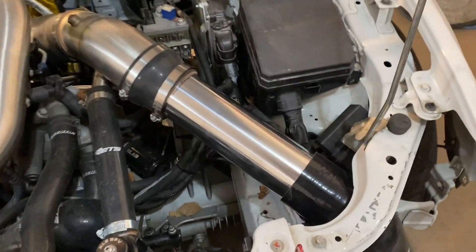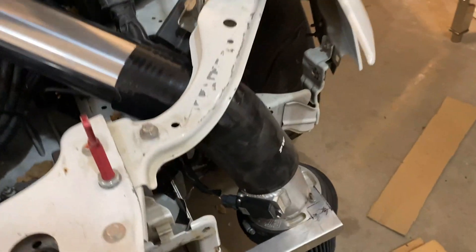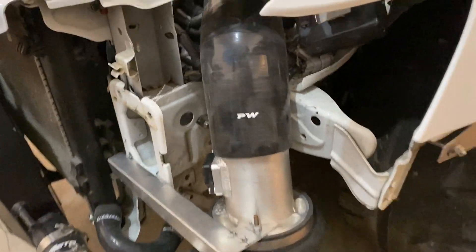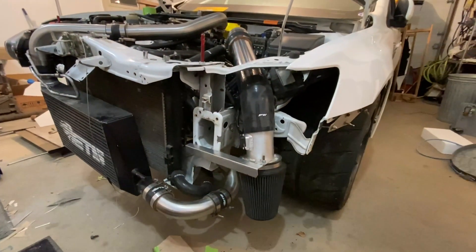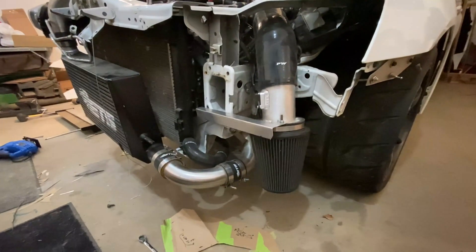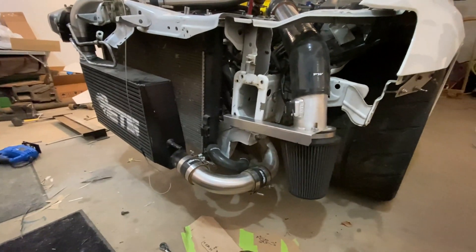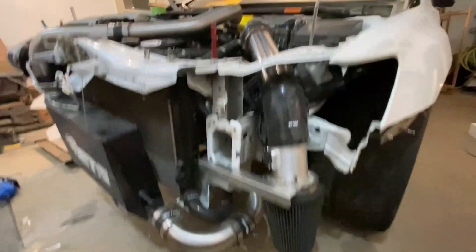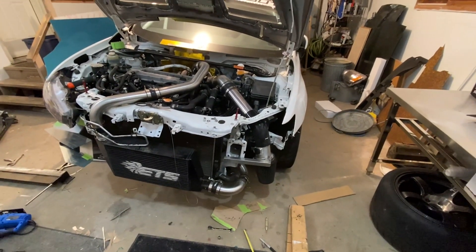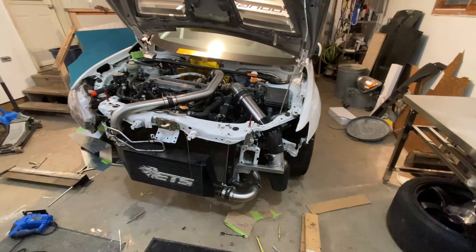I just finished up the intake and this is what we've got going on now. I extended it with just a three and a half inch piece of pipe and moved the mass airflow down, bending up a bracket to hold it. We should be getting cold air. I just have to figure out if I want to pull it through the fog light where it would have been or off the side of the intercooler — just kind of see what will be better for aero, keeping as much of the front end closed off as we can while keeping it cool and not restricting it power-wise.